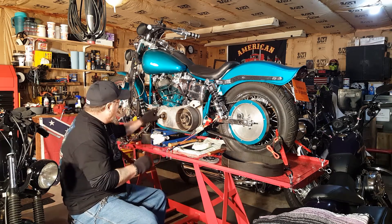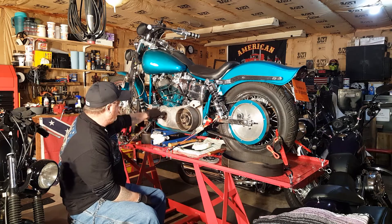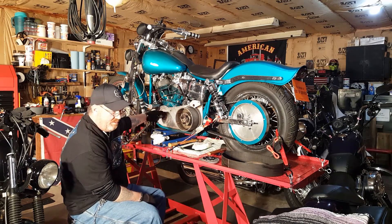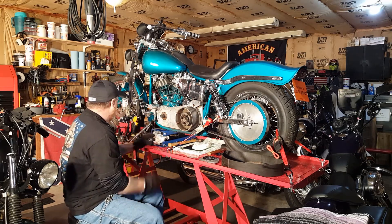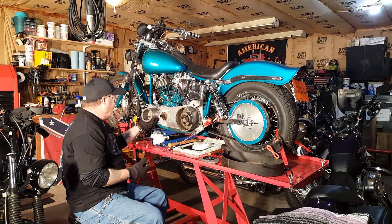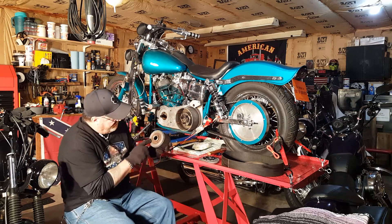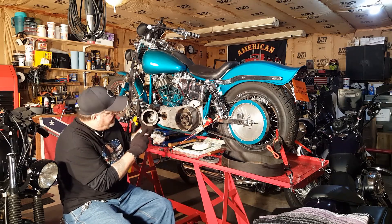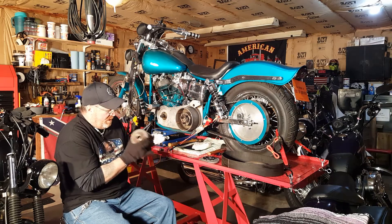I finally went old-school scorched earth on it — not to damage it, but just like any garage mechanic, you gotta do what you gotta do. This is a one and five-sixteenths nut and that holds the front pulley. The pulley goes on here and it's actually a dual-plate pulley — you can see there's a whole other little plate here on the inside. There are three Allen bolts that hold this on the splines — that's what holds this pulley together.